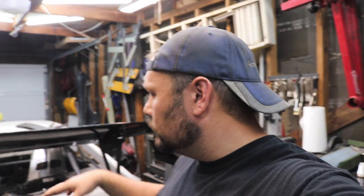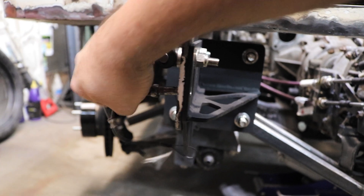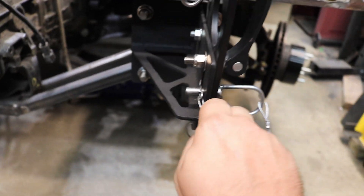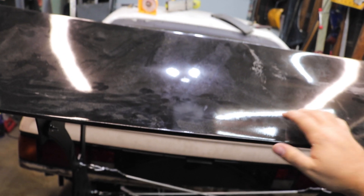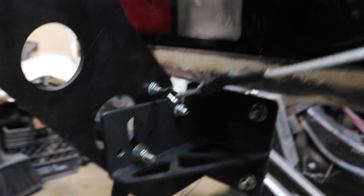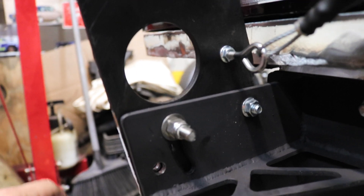And in case you need to access the hatch — which obviously you probably would — I made that fold-down mechanism. Here's how it works. On each side, you go over and pull this pin, flip the cam lever down, and do this on both sides. Then stand back and slide it back. And with it slid back, you can come in from the side — there you go, you're into the hatch. I cut this curved slot in here for the cam to follow, and that's bolted in. That way it just follows that slot and goes back up.